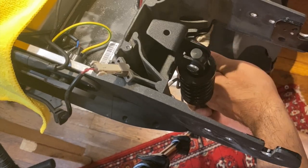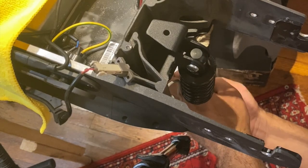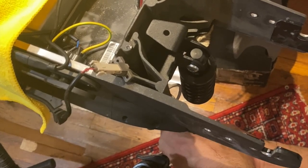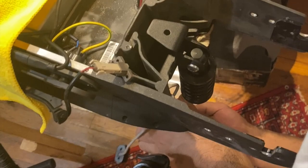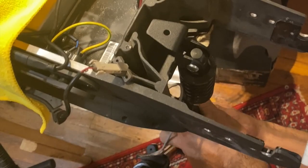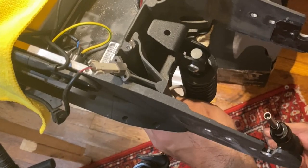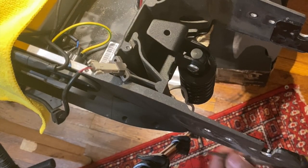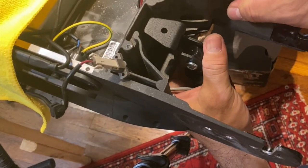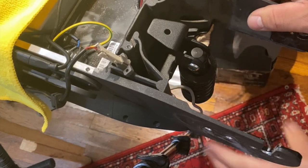At this stage I don't want to fully tighten the screws — I just want to leave a 1/16 of an inch gap between the suspension and the base of the scooter. The reason is to give that little space for the support to clamp together once tied up fully. Once the support is installed it will clamp together, make it really solid, and ensure there are no gaps.